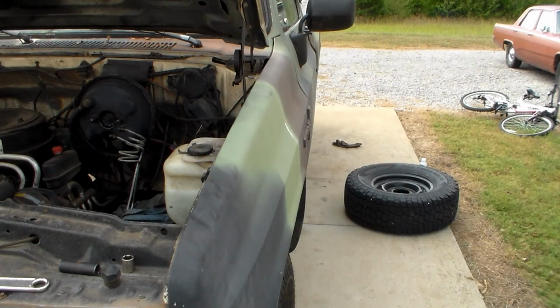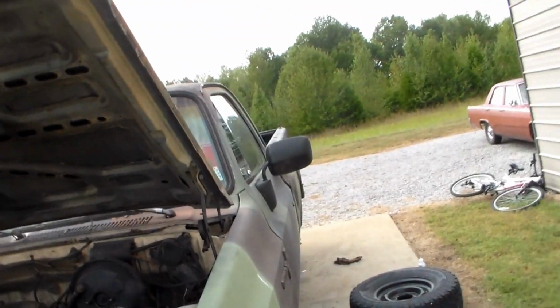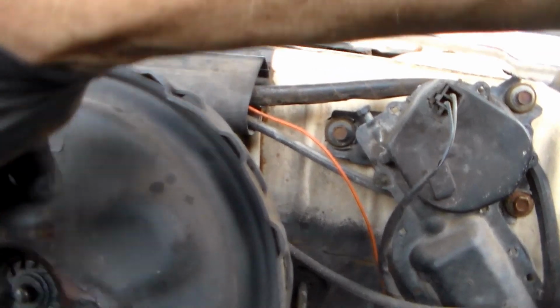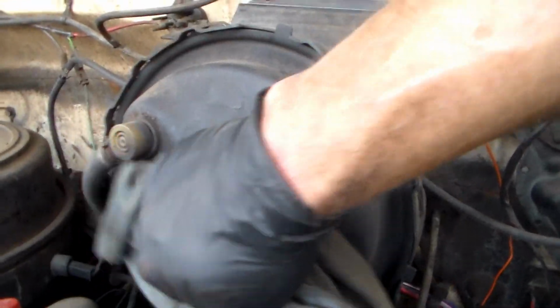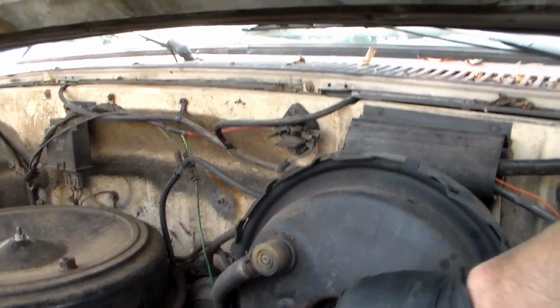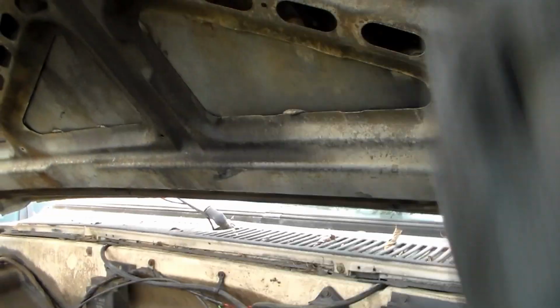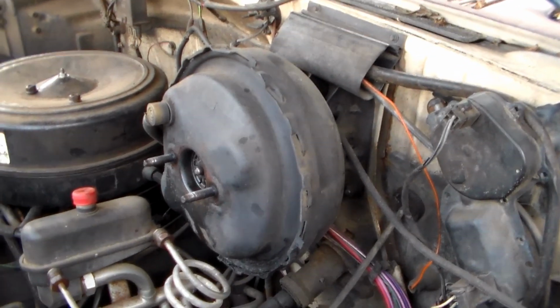You can look at it, or you can see, take it off of here. You can see where it's been gripping that. I hope I didn't take that booster out. It's not good for one to be leaking down in here, but maybe. See, it's all been. Yep. Great. Okay, I got to get in there and bench bleed the new one. Let's go do that now.